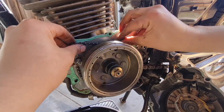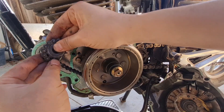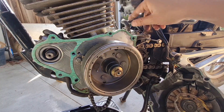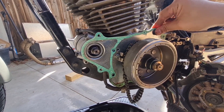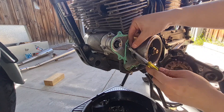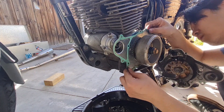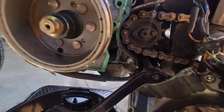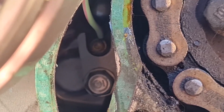There's a chain around here which joins up to the starter motor over here - it's definitely not my first time messing around with this stupid mechanism. In order for me to get that back on I need to take the starter motor out, but that's fine. What I'm going to do is try and remove this bolt here and see if that will hopefully loosen this plate, so I can reach behind because I really don't want to take this whole thing off. Bingo - we can take it off a little bit. Hopefully that's enough to see what's going on inside. See that little gold thing there? That's what I need to get to.